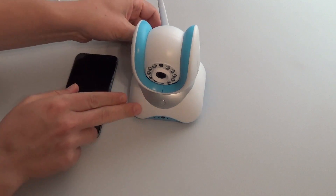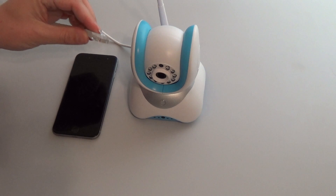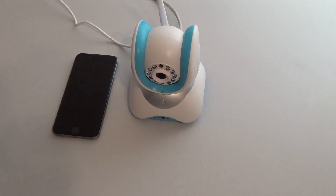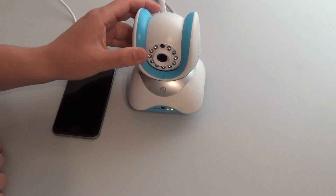Take your power cable and power up your device. Four LED lights light up on the front. There's a slight clicking noise, and a continuous beep indicates the camera can now be configured. Take an Ethernet cable connected to your local network and plug it in. A single yellow LED lights up indicating that the device is connected.